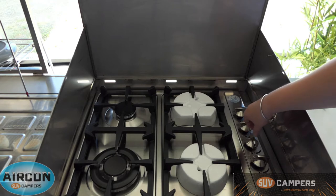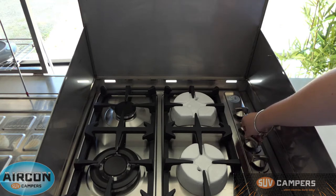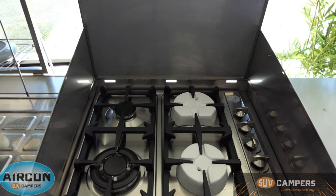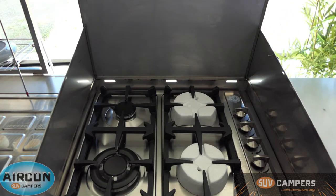That is the highest point of the flame. If you want a low flame, just keep turning anti-clockwise until you get the flame you want. If you want to go higher, turn clockwise. Every burner also has a flame safe on it — what the flame safe does is protect you if the flame gets blown out for any reason. Once you're done cooking, give it a quarter turn clockwise and that will turn the flame off.